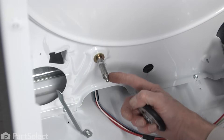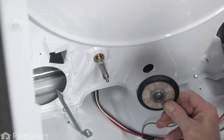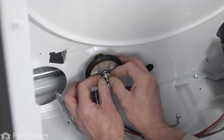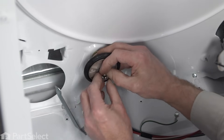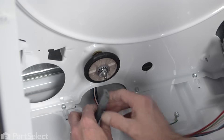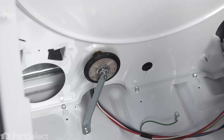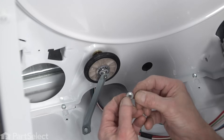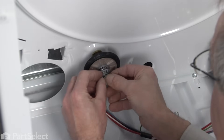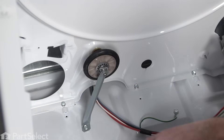Slide them on over the shaft — they will probably pop into that first groove and you'll need to lift them out the same as you did to remove them in the first place. There's no front or back to the roller; merely slide it on the shaft. Take your triangular retaining spring clip and press it into place. Now reinstall the support bracket, slide it over the front of the shaft, take the new spring clip push-on nut, press it onto the shaft, and re-tighten the screw.